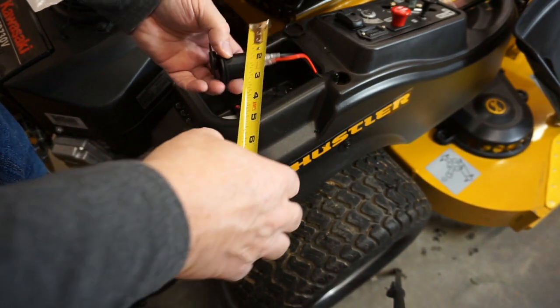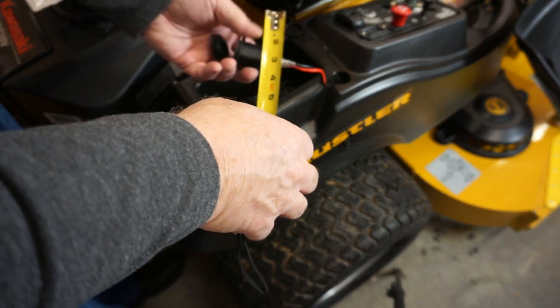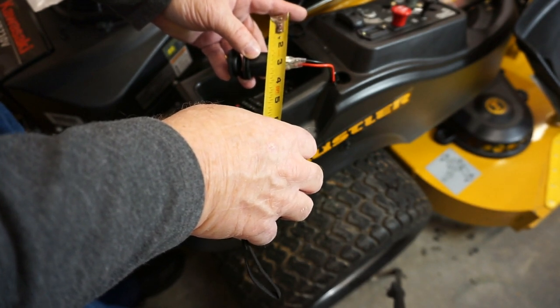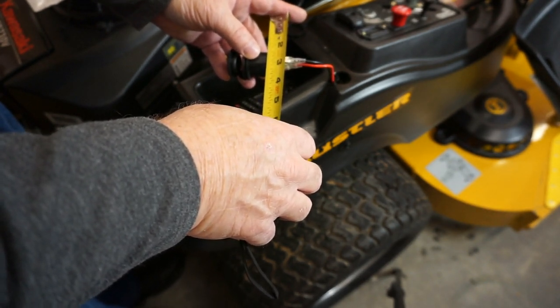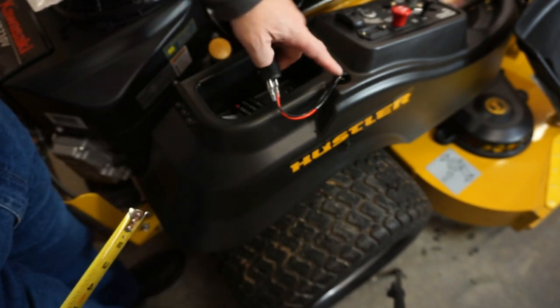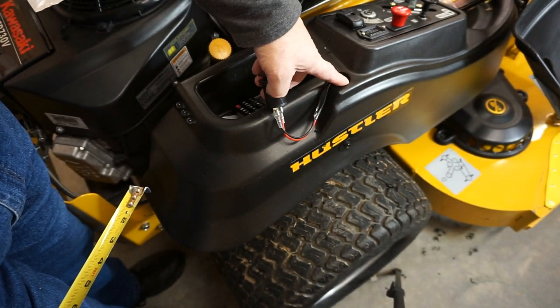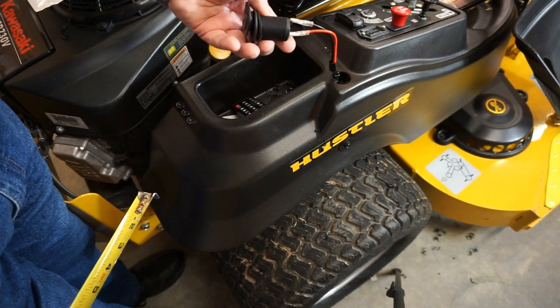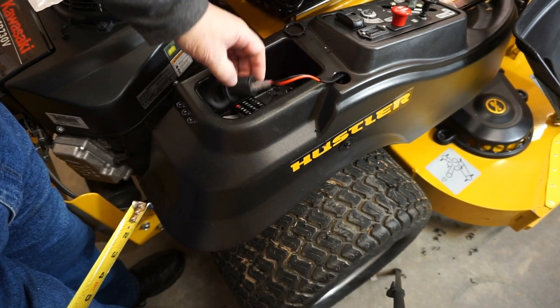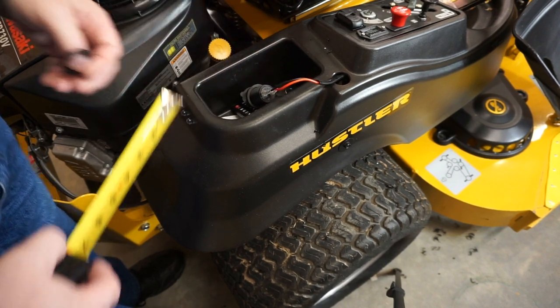And I always come over here and find a number like this, start at 2, and we'll go over to the other side, and that's going to be 1 1/8 inches. So you're not taking that much off. You're going to take off a 1/16 on either side. That's not a great deal. That's really just about the depth of your threads.